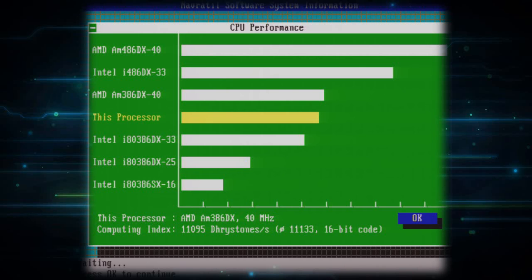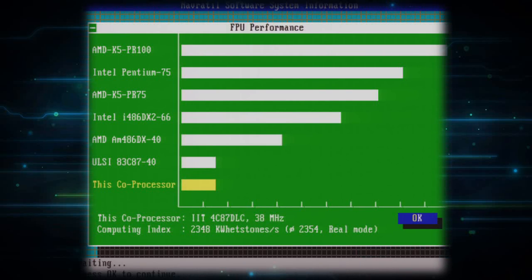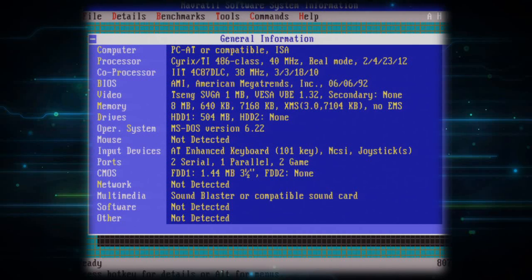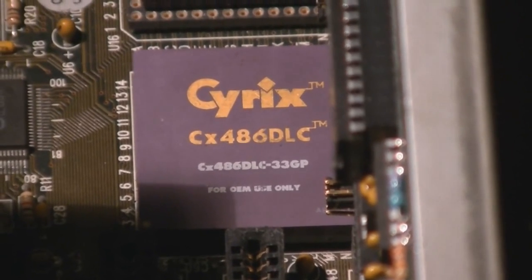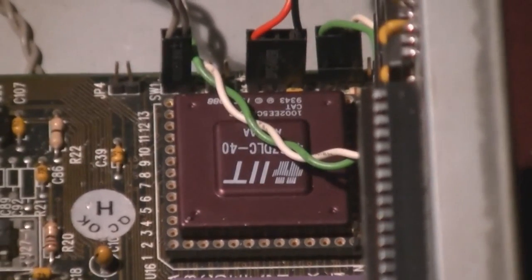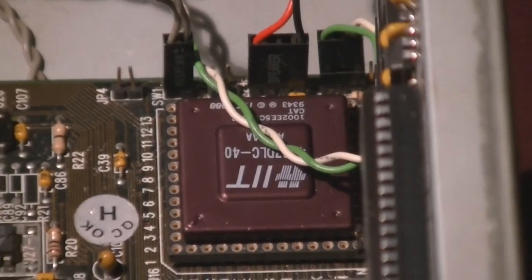The results are 11,095 Dhrystones for the CPU and 2,348 kilo-Whetstones for the FPU. The Cyrix is back. What Cyrix essentially did was wire a 486 to the bus of a 386. None of the other CPUs have internal cache, though this one handles the external cache differently — and that is disabled by default. IBM used one on an expansion card for a 286, but like most IBM parts the machine sucked with or without the card. So is this CPU any good in a proper PC-compatible clone?